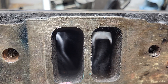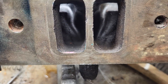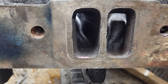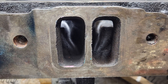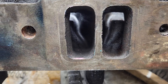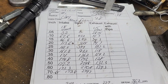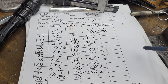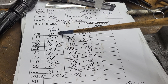We're light challenged today so we'll do what we can. I have to charge my lights. Absolutely tiny port - okay, you can see how much bigger even a 318 gasket is here, right? So they're tiny ports as far as the pinch. But in reality they work fairly well. I would say these do as well as Chevy 305 heads, pretty close to a stock 083 head. Remember, 083 heads got a 1.94/1.5 valve - it's actually got almost a full port on it but it has a hole in the roof. Still, those work up real nice.